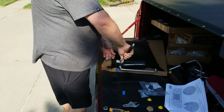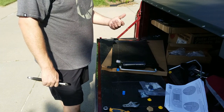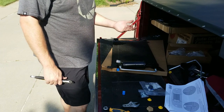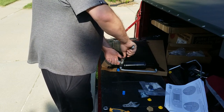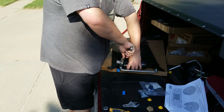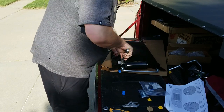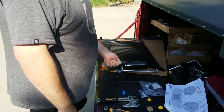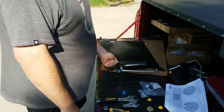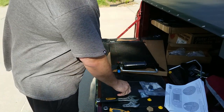And then I realized that since the Classic Auto Air has that second lead coming off the AC trigger, I'm just going to use that as my trigger switch instead of using the trinary switch. Now, that could cause the fans to come on when the AC is not actually running, if it's cycling. But I don't care. I mean, if I've requested AC, I want those fans to be on.